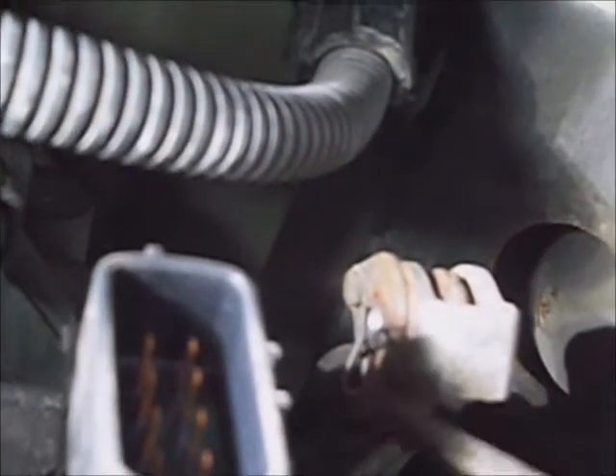This sensor stays with the transmission — they usually come with one, and it's still salvageable if you need it. I'll just take and lift this clip up on the transmission range sensor arm for setting the gears — raise that clip up. While you're under here, take the 10mm out of that ground cable. The superficial work is done underneath here, and I'm going to let it back down and go on top.